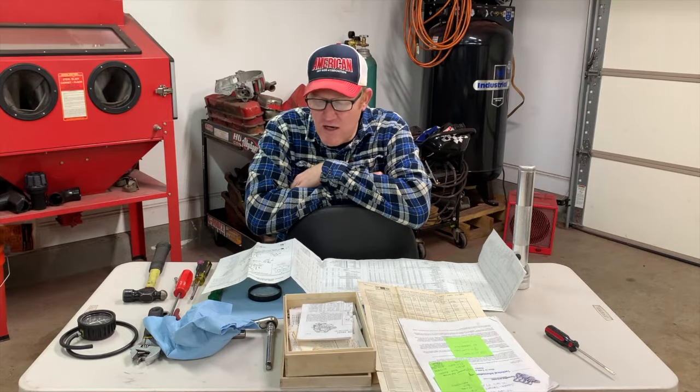you have the radio playing, you had to have it in the accessory or the key on position to do such. If you had it in the key on position and it didn't require oil pressure to apply electricity to the choke, the choke would continually heat until it either burned up the element or the truck wouldn't start because you sat there long enough that it had cooled off, but the choke was still wide open. And so it wouldn't start well and you'd flood the vehicle.